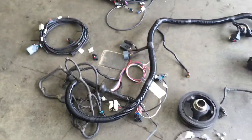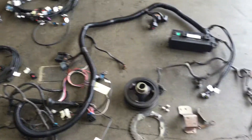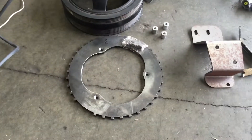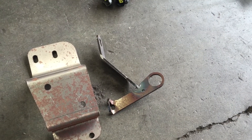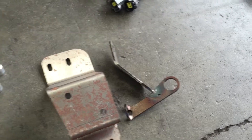This is for a Gen 4, and just so happens that this Jeep is an 05 LJ. So to get the TAC to work in the 05 and 06s, we run a tone ring. There's a throttle pedal bracket and a crank sensor mount so that you can get a TAC. It makes it really simple.